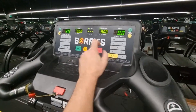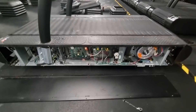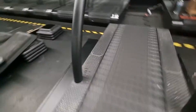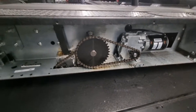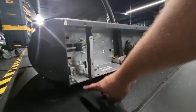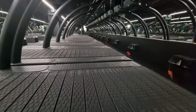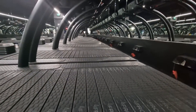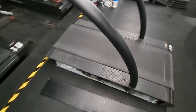Then we can go for incline, for speed, whatever you want, and confirm that the track's going and the circuit board's liking it. Around here the incline is working as well. The machine's fairly level — you want to check the levelness of the machine, like the gap between here. Check on another treadmill if you've got others and make sure the gap's about right, so that the tops of the machines are all level side by side. You need to adjust them so they're at the correct level zero so the clients get the most out of the machines.